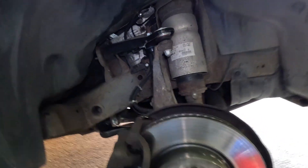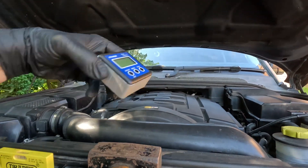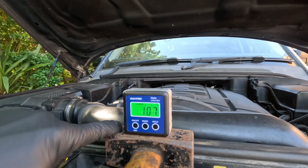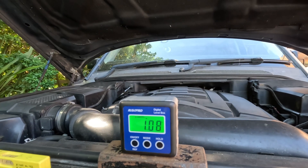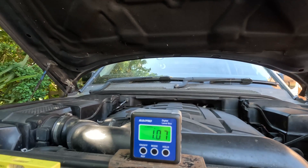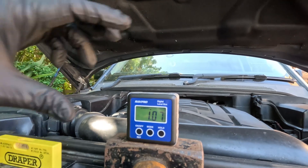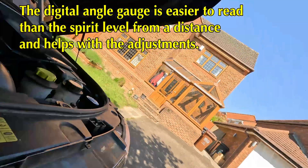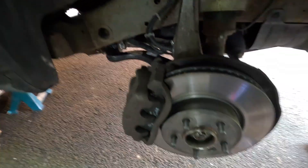I'm kind of starting again from scratch today. I've got a center point here with a spirit level, and I also bought one of these cheap angle gauges off Amazon. I've got it as level as I can get it — I don't know if the car is completely level but it's tilted about one degree in that direction. If I can get nearer to zero degrees, we've got a good chance of setting the camber roughly right. Once it's looking stable and the spirit level is complying, I'm going to jack up to ride height.